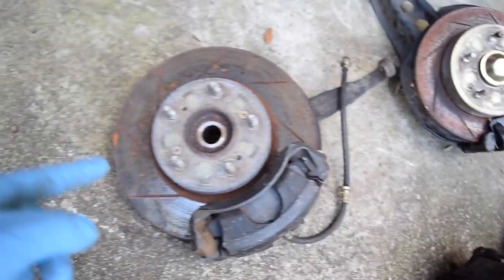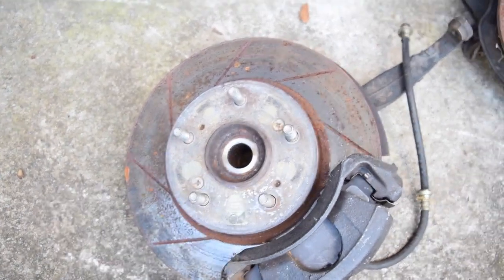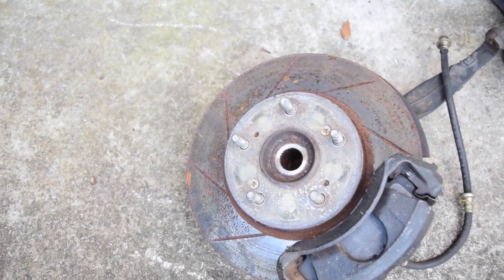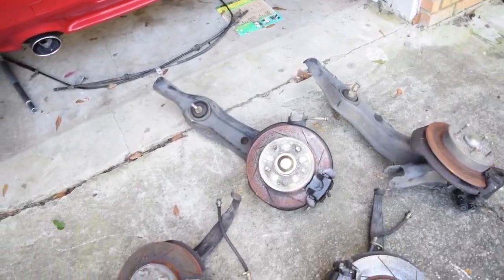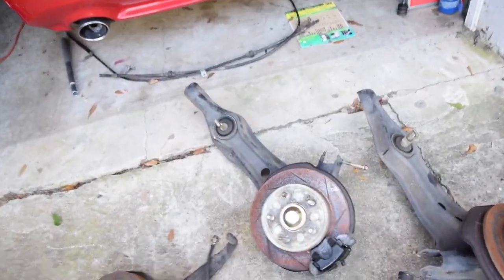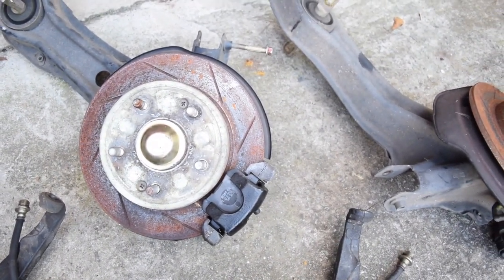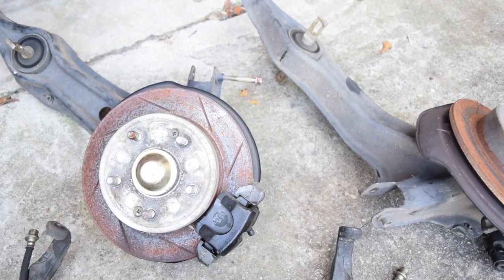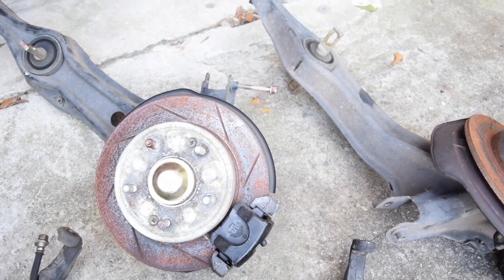So basically this is what you'll need for your 5 lug. If you're going to do a swap like mine, make sure you get a 32 millimeter front spindle. That's what fits with my B series, but if you're running a K series or something that uses a 36 mil, then go ahead and get the JDM 36 mil. Civic Type R's and USDM Integras use 32 mils, and then the Japanese JDM Type R Integras use 36 mil.